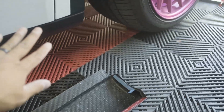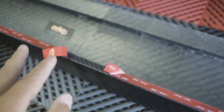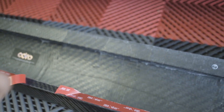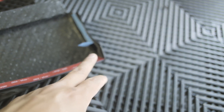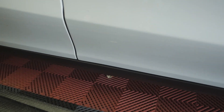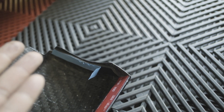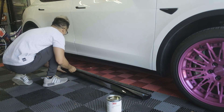I've cleaned and prepped the side skirt with the promoter and alcohol. The tape was one whole piece — I sliced it in the middle to break it in half so I can go left to right, making sure the side skirt is in the right position before it adheres. I decided to tack down the middle first and then work my way out left and right. I noticed it has a foam backing, which should help with any noise and vibration.